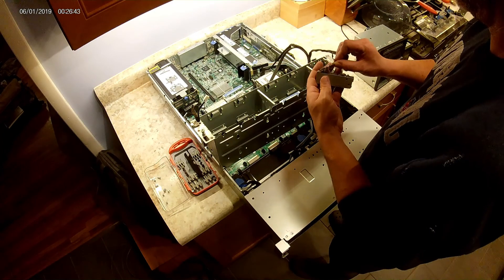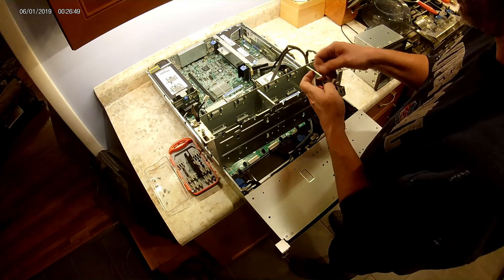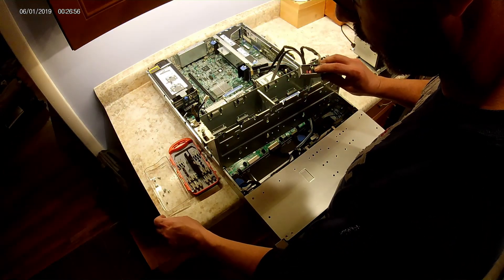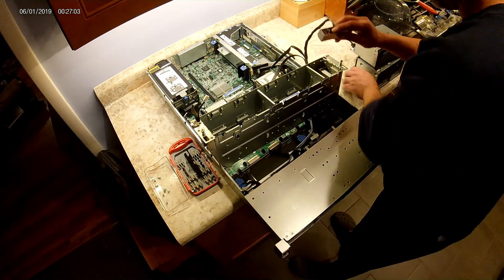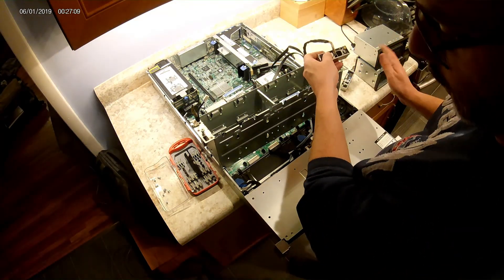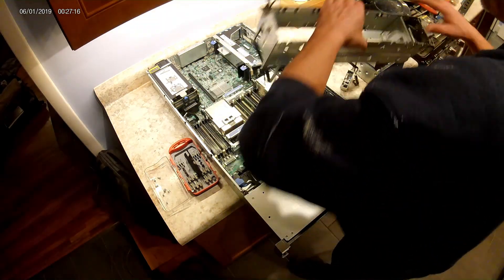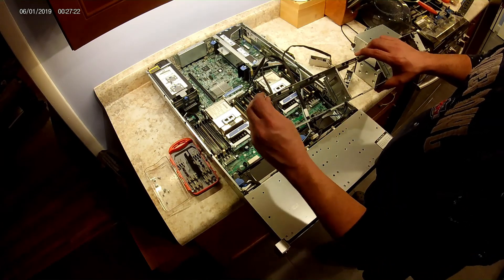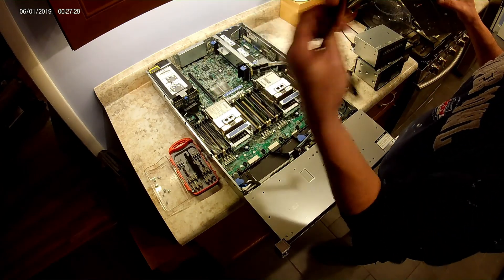To provide a common ground for the entire circuit, on this cable there's a multi-pin connector. Then you put in the little ground ring and screw it down. That's how that works. The biggest challenge is getting the cabling through — it took me a while to figure out I could just push it through. So now you can take your 380e cabling, get rid of that, and use your 380p cabling instead.